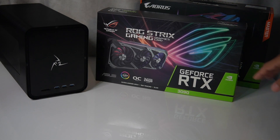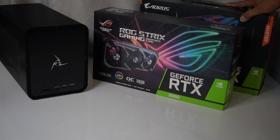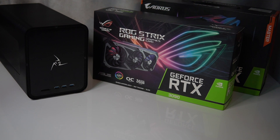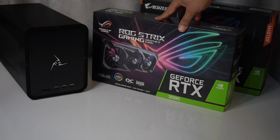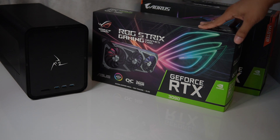To conclude, I've brought out both GPU boxes to show the difference. The ROG Strix is the one you want; the Aorus is the one you don't. The Aorus only requires two PCIe plugs but won't fit in any eGPU case. The ROG Strix requires three PCIe plugs, fits in the Mantis, and can receive the power the Mantis supplies — but will not work in the Razer Core X. This GPU and this enclosure are a perfect fit if you want a 3090 as an eGPU.